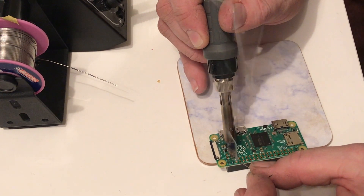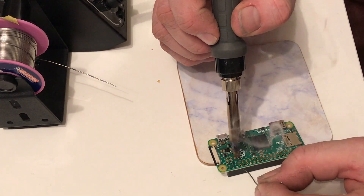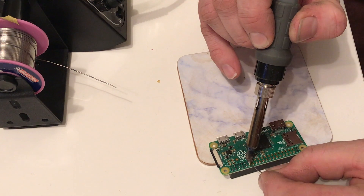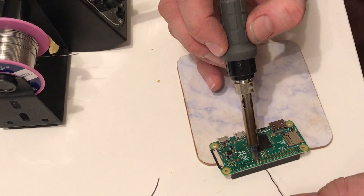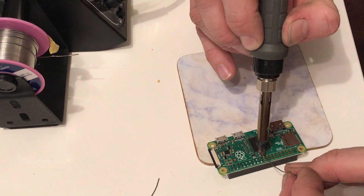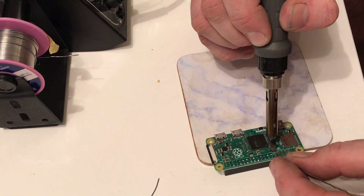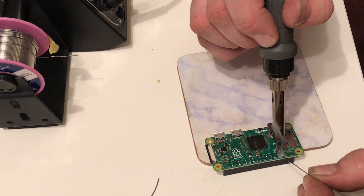It's quite important to be careful with your soldering. I've sped this video up somewhat because it's not very interesting watching someone solder, but you have to be careful not to get the pins bridged or any stray bits of solder about the place. It's very easy - it's through-hole, nice and easy to do, and it literally takes five minutes. It's important to keep the edge connector straight, in line, and flat to the PCB when you solder it. What I usually do is solder one pin at each corner first, make sure it's straight, flat and level, and then solder the rest. Just put a tack solder in each corner and away you go.